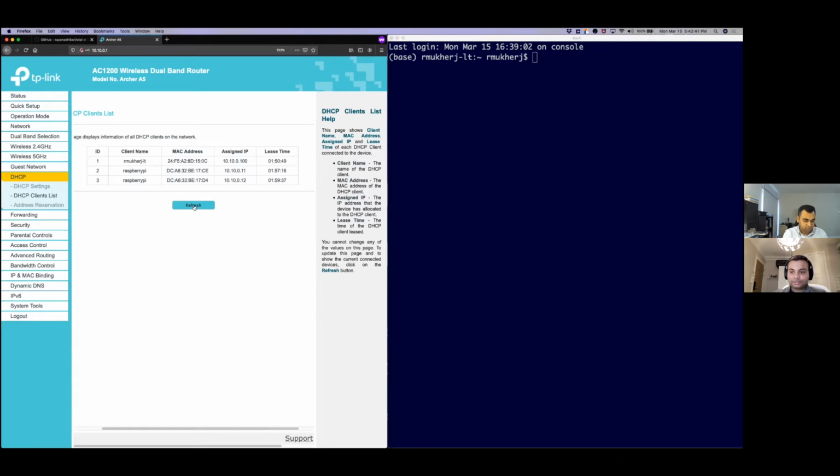There are different indications that let you make sure it is properly connected. We are trying to show you how to configure this router because it's a very straightforward and simple thing. You can use it for any router available in the market, as the settings are almost the same. There is nothing specific about this one, so just follow the individual router's page. Try to set the LAN IP first, then turn DHCP on and put in these IPs. And again, I'm repeating that if you don't want to use DHCP and just want to assign the IPs yourself, you can still do that.